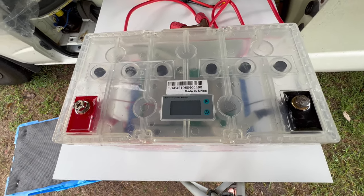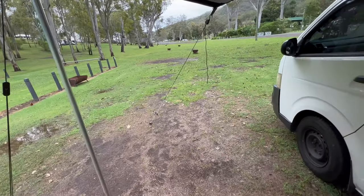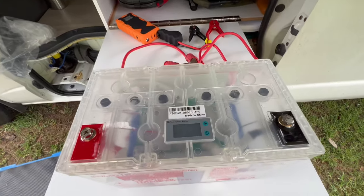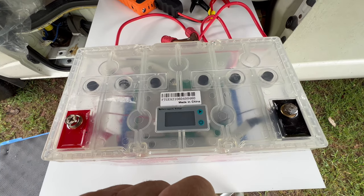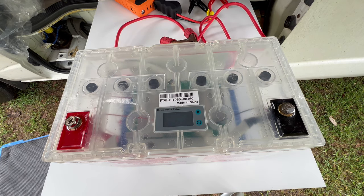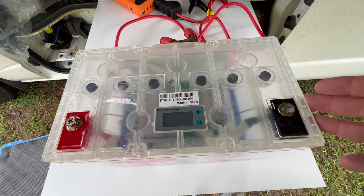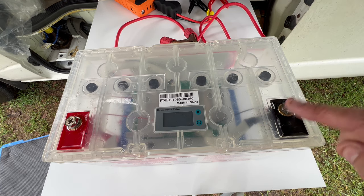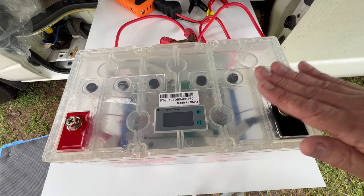This can happen also if you're camping — it's overcast and you've used all your battery power. The only thing is, now you cannot charge that battery because your DC charger in the vehicle or your solar charger will not recognise a battery being in the circuit because it has actually shut down. DC chargers have a safety feature that if there's no battery present, they won't charge. So the DC charger can't recognise a sleeping BMS, and once it's gone to sleep, you won't be able to charge that battery.